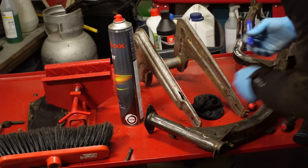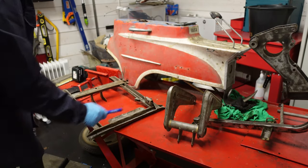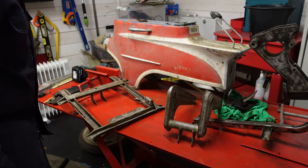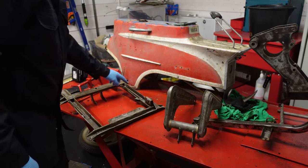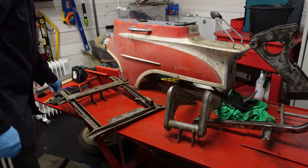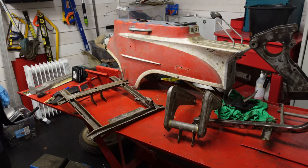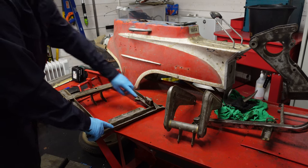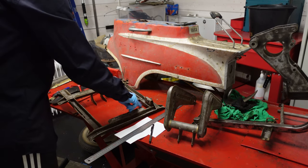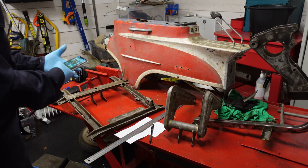So somewhere here I will need to create a small patch there. And also this plate needs to be redone, it's super thin. I will also try to fill in some of these smaller holes here, but let's see, it might be a difficult task for me with my TIG welding skills. But let's remove the plate and create a new one for that. I marked the spot here so we know where it sits. I'm not going to create those cuts on the corners, I will just do a small border radius there.